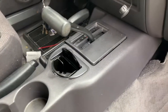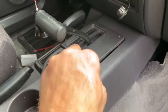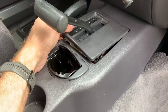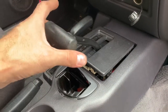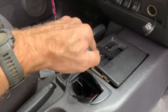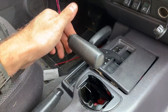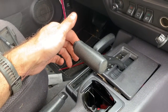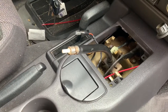Just like that, the T-handle and the cover has been removed. Then we'll do the same thing here — hit it in four-wheel high or neutral just to give yourself some room, then pry up gently. It's 21-year-old plastic, so you don't want to go crazy on it. And there we go.